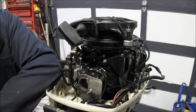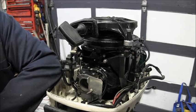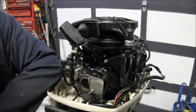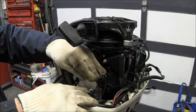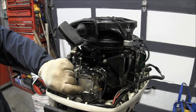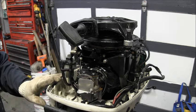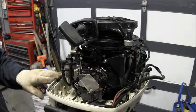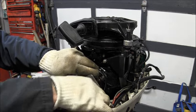It has a primer. And that I can see, the primer's hooked up. I don't see no busted little nipples or nothing. But that's what they were doing. When I unloosened that and figured that out and saw this, they were using that as a choke. Pull the bonnet off, choke it, blah, blah, it starts. Put it to half choke. How about that? Never seen that before.